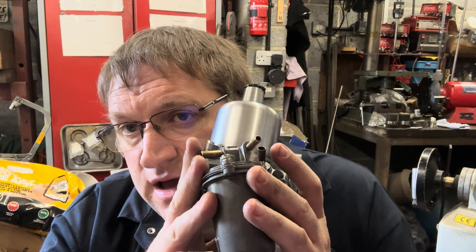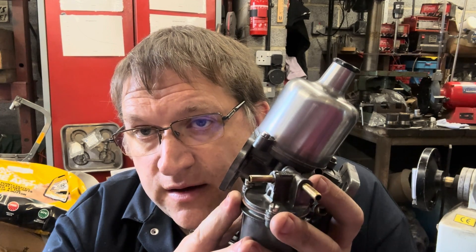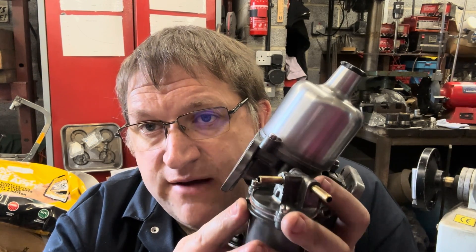In order to get the best fuel economy — in summary — we need to control the fuel going through the engine and only put enough fuel through to maintain a good burn. That means around stoichiometry or around the misfire limit, just potentially a tiny bit richer to account for different days so you don't run into misfire limits when using the car all year round. The beautiful thing about an SU carburettor is it is a performance-with-economy device. It is within the realms of this carburettor to do 60 miles to the gallon and also produce 100 horsepower at the same time. That is absolutely possible, but only if everything is right and the car's driven properly.